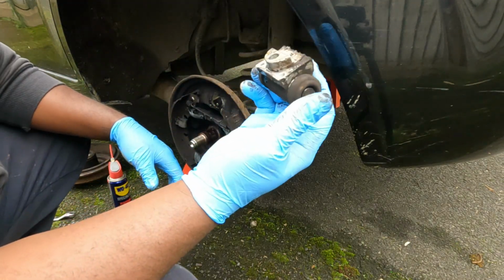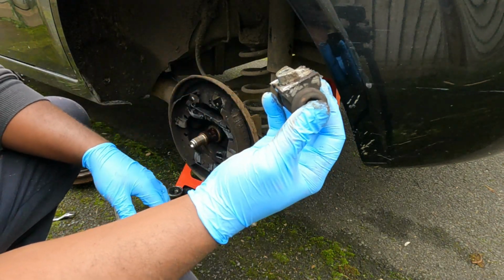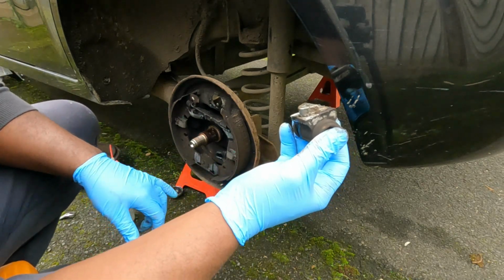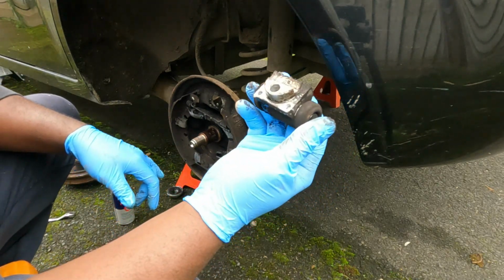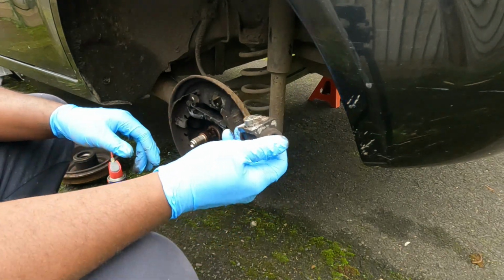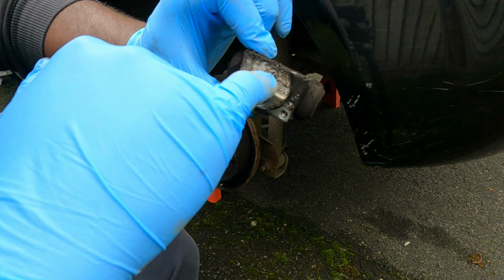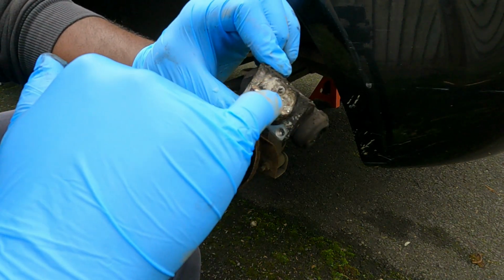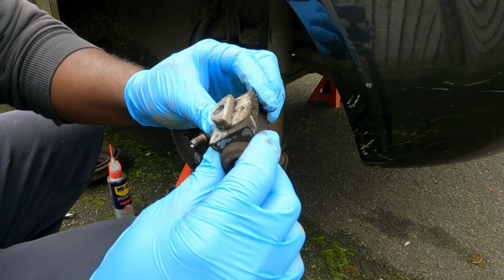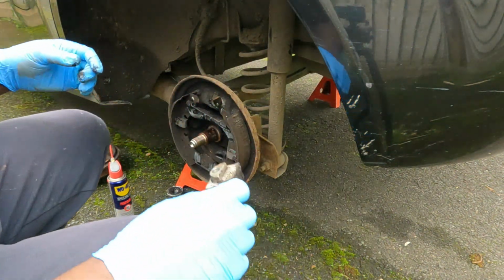And be careful pulling this off, because I just pressed the wheel cylinder and squirted brake fluid all over me, all over my hands. Luckily there's none on the brake shoe, but either way I have a can of brake cleaner nearby to clean everything up once you're done. And as I said there, the brake bleed valve broke there, and I tried to remove it with the extractor bolts, but they broke too, and I'll never get that off, so new wheel cylinder it is.